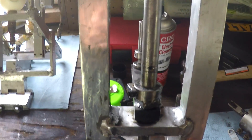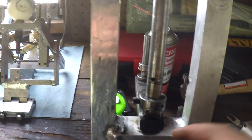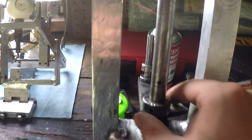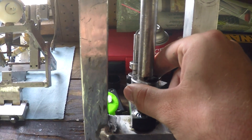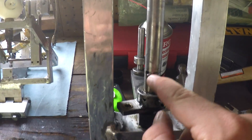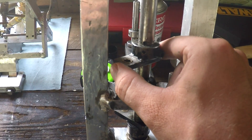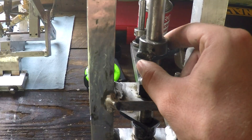Okay, I'm putting it back together, but I need to really think about some things. The head turn was messed up because the roll pin was gone. From the way I took it apart, this is how the collar was oriented — it wasn't flipped 180 degrees. There are only one or two positions this can be locked in. From the marks and scoring on the rod from the Allen screw, it looks like it was locked in this particular way. I'm going to have to check whether that's correct or if it's supposed to be oriented differently.